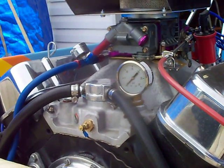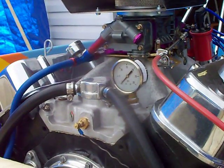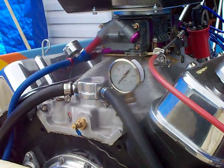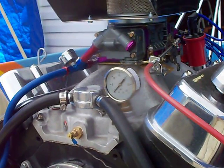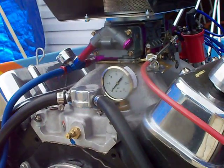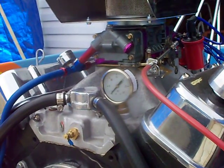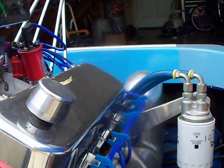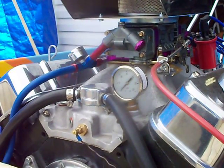What you do is put a restrictor plate inside the thermostat housing. Moroso sells a restrictor plate kit for the thermostat housing — the kit comes with three different plates; I believe the hole sizes are half-inch, five-eighths, and possibly three-quarter. I had an old Moroso kit with two of the fittings. I ended up using a half-inch restrictor because I have basically a half-inch coming in and a half-inch going out, which allows it to fill the void in the block.